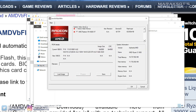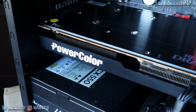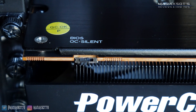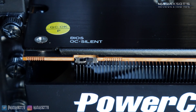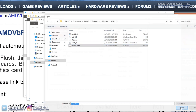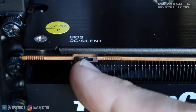Now we're just a few clicks away from significantly increasing the performance of our 5600 XT. One important thing to mention: you'll notice on the Red Dragon — and I assume the Red Devil is the same — that you have a little switch. This card is a dual BIOS card, so you can choose to operate on the OC BIOS, which is the higher performance BIOS, or the silent BIOS, which runs the fans a little slower, making the card operate quieter. Whichever BIOS you happen to be updating, make sure your switch is set to that particular BIOS mode. For this video I'm going to update the silent BIOS, so I make sure my BIOS switch is set to silent. If you're updating your OC BIOS, make sure your switch is set to OC.